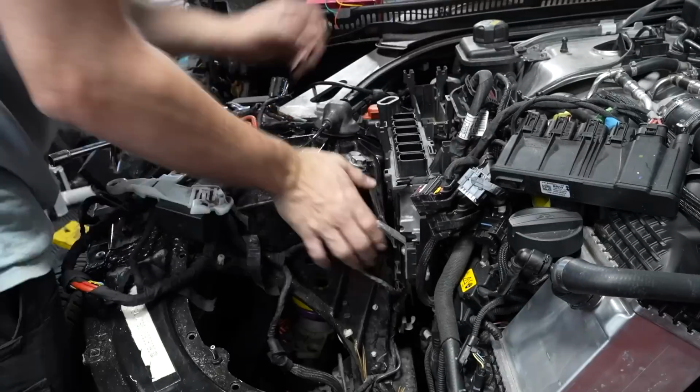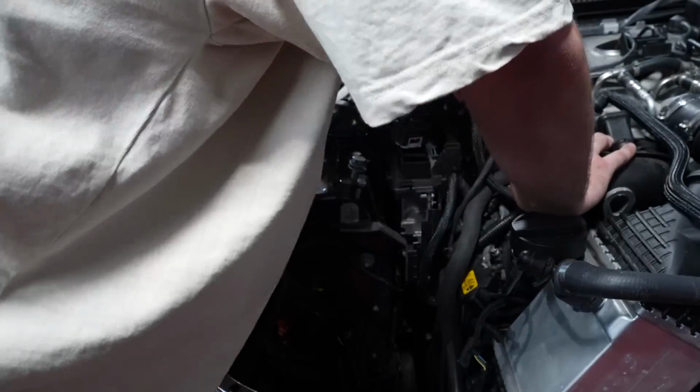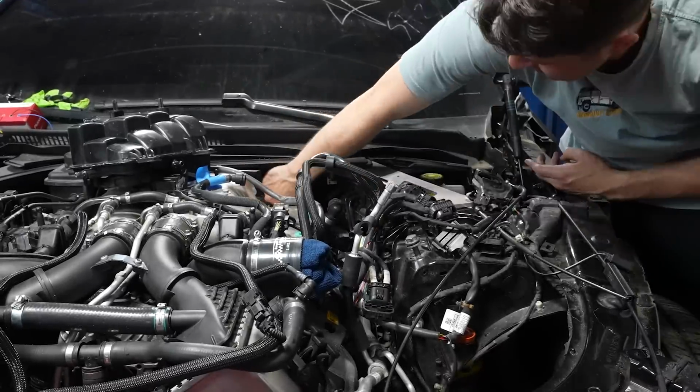After moving the hardline out of the way, we can relocate one of the hoses for the coolant reservoir to where it's supposed to go. With that done, we can now bolt the reservoir down and hook it up, checking one more box on the long list of connections in the cooling system that we need to install.